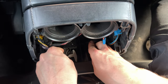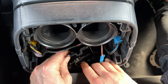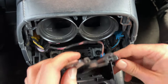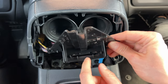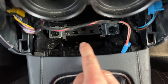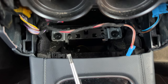Now you can grab this panel, lift it, and there is a light here that you need to disconnect. We're actually just going to tilt it and remove the whole thing — it's held on these clips. So that's what we did because it's easier to do it this way instead of trying to disconnect it. With that panel removed, now you see four bolts: two silver ones on the inside and two black ones on the outer side. We're going to use our T30 Torx and remove all four of them.